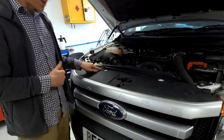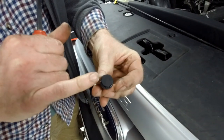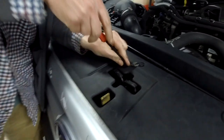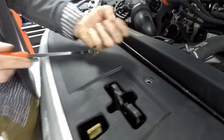The one thing we've worked out is the poppers at the top. These are two-part poppers and you've got the middle bit that comes out. They've got little cut-outs - on some it's on three sides, on some it's on two sides. You can get a little bit of access there with one of these little trim tools and pull them out.